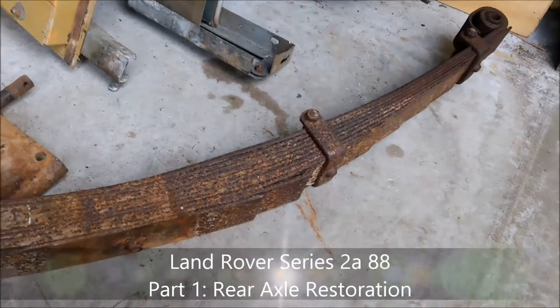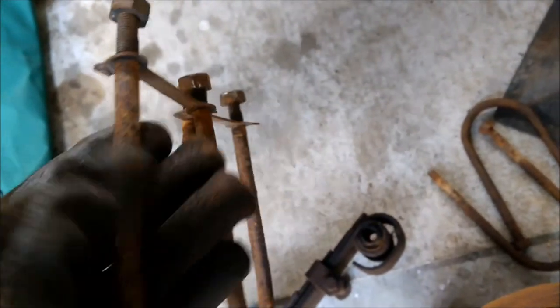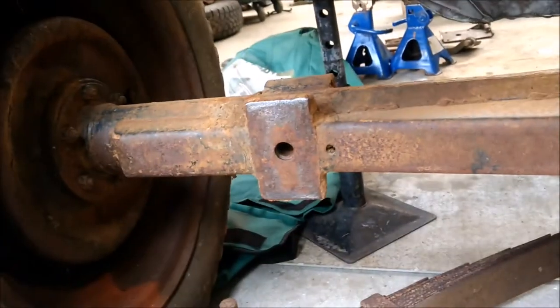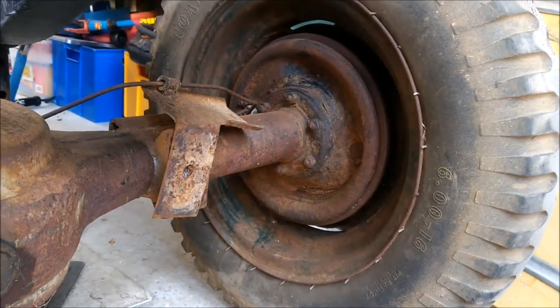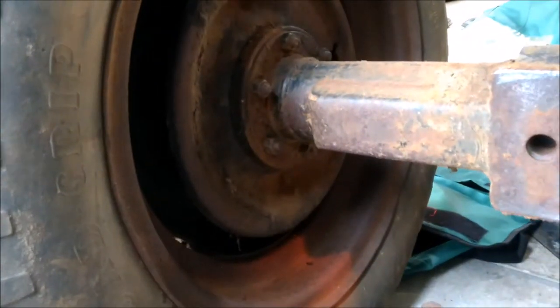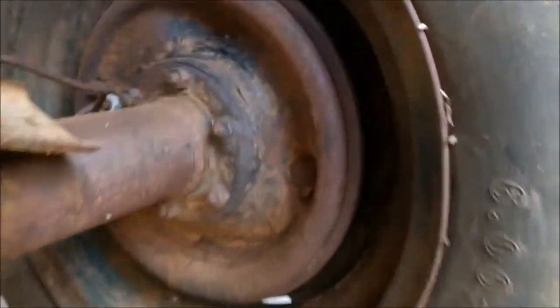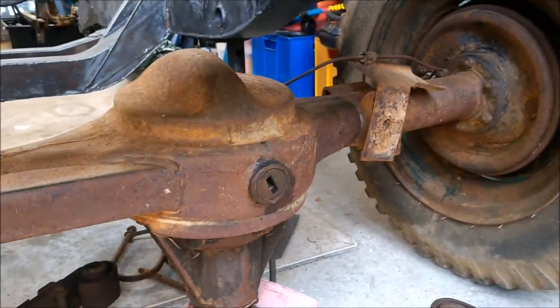Along with the disassembly of the axles - just like with the front, this is the back I've just disassembled. In this particular case, one of them did actually have lock washers on it, but they're all going to get replaced anyway. I've got this axle pretty much free. I'm going to start from the outside in, pulling these two rims off. On one side you can see there is a brake mechanism, however on the other side it's been removed with the intention of replacing them - this side has brake drums, so we'll just start dismantling.